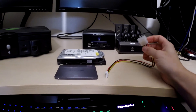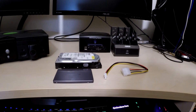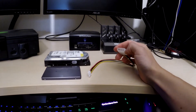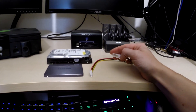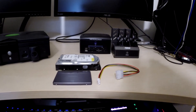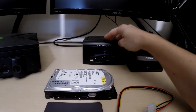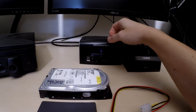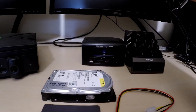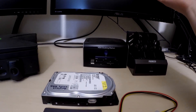At a certain point you may need additional power. Something I don't have on here that may also be of interest is a Y-splitter for one of these Molex connectors, just in case you ever need to reset your hard drive to stock using the original Xbox HDD with a soft mod on it, or using a friend's hard drive — for whatever reason the process fails. Something else you're going to need is a USB docking station. You don't necessarily have to have a docking station; you can use a USB enclosure for your hard disk, but you want one for your PATA hard drive and for your SATA hard drive, which is why I'd recommend going with a dock station.